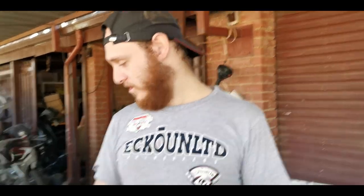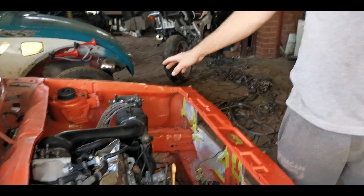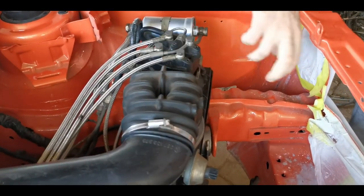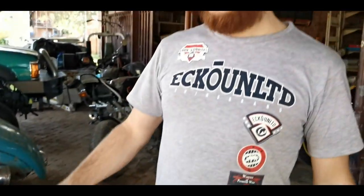Everything is fine. So what I think is, on the fuel injection box, maybe there are some seals and stuff that have dried out because it has been standing for a long time. I googled how to open it and how to replace the seal, so for now I'm going to do that. I'm going to open this small black box here, take everything off and redo that box. After that we'll try to start it again and see what it does.